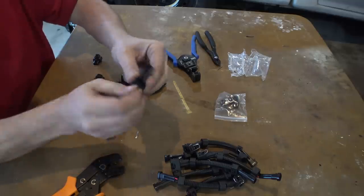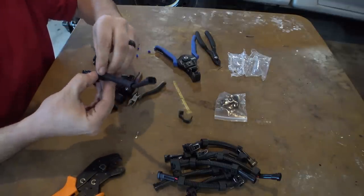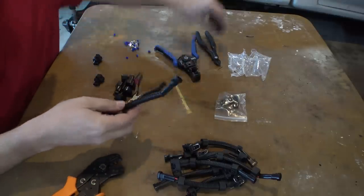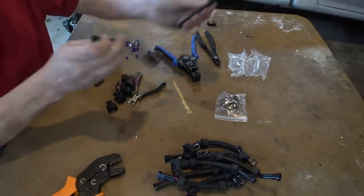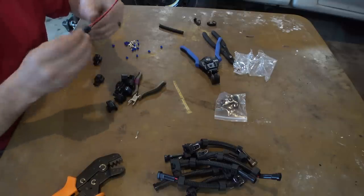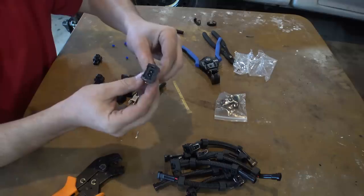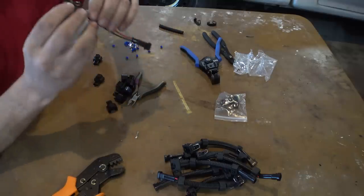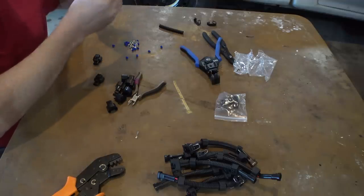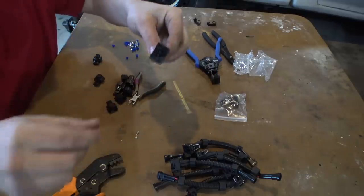So I'm going to take apart this connector. We'll put the loom stuff back on to keep it all nice and neat. I haven't done this yet and I only have so many connectors, so we're all going to learn at the same time. I considered popping the pins and sticking them in the other connector — that would be a fascinating experiment — but I don't think so, not by the way these blades look. Let me try to punch the pins out with a pin removal tool.